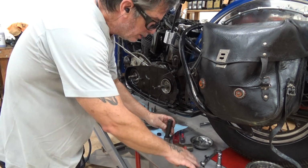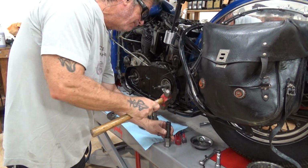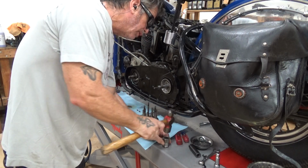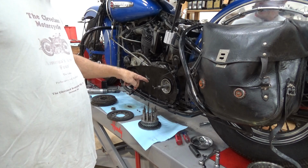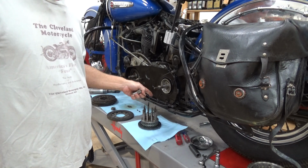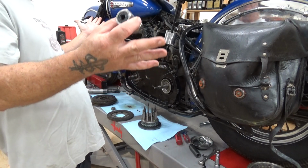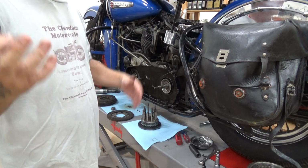Okay, here we go. Proper socket. I'm going to push that down. Put our second seal in place. Always double seal these. This oil is a direct puke from the transmission into your clutch. It's a dry clutch. That means no oil. So double seal it so you make sure you have no oil. How complicated is that? You'd be amazed how many people won't do it. You're a shop, guys. You charge the customer an extra $1.50 because you double sealed it. Is that hard?